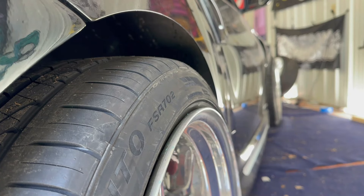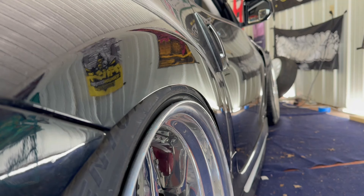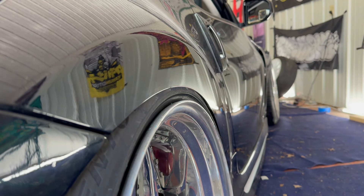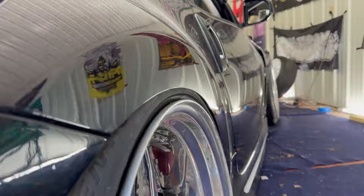It's looking like it's still giving me a little bit of a problem even with me grinding down that little piece. In the next video I'm going to trim down these rear fender tabs just a little bit — I think they are what's actually holding up the tire. Worst case I do have adjustable camber arms on the car so we can throw an extra degree at it. I'm just really trying to keep the fitment super dialed in and tight.